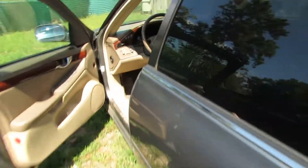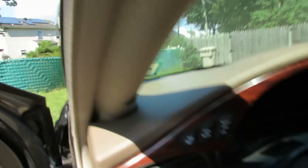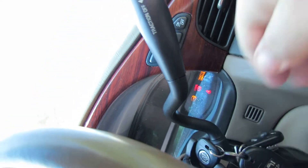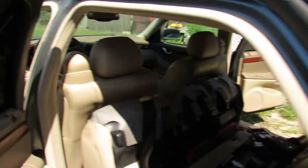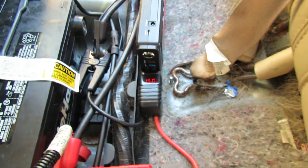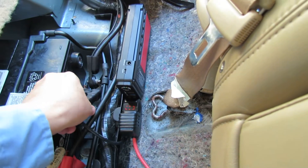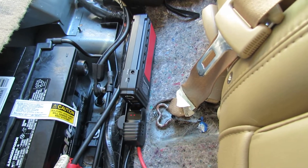Showing 15.2 volts on the Foxpeed — I hear the chiming. This unit does not have a boost button like I just mentioned. The car started up on the first shot, the very first shot. The Foxpeed without the boost button is showing it's delivering 14.9 to 15 volts.